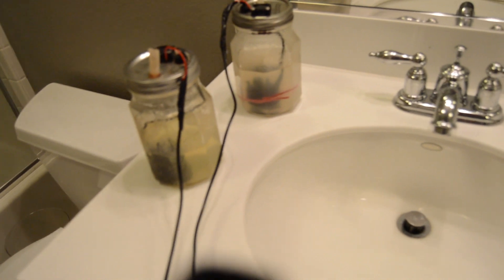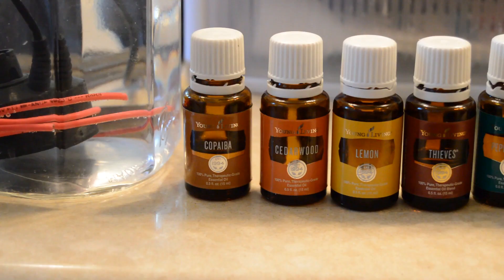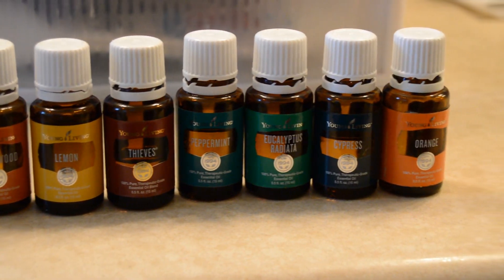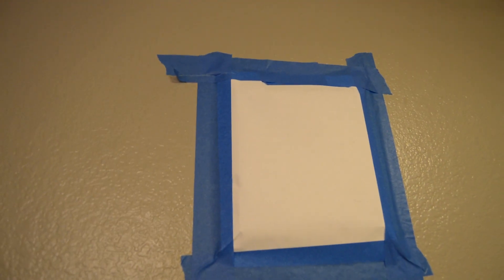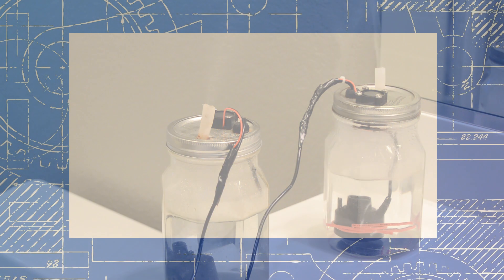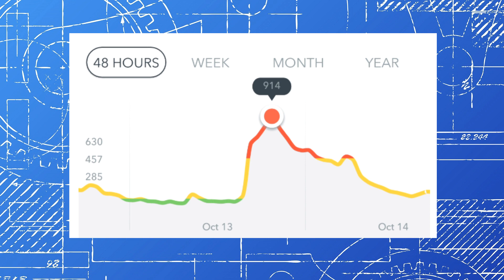Now for something more controlled to see how effective this filter is at removing VOCs. I placed the air filter in my kid's bathroom with a couple of essential oil diffusers — these diffusers were made by me, and you can see how I made them via the link in the video description. I used essential oils because pure essential oils are nothing but VOCs and will completely evaporate at room temperature. I used a lot of different essential oils because each oil can contain over 100 different volatile compounds, and mixing and matching should produce a slurry of thousands of different VOCs. To run the test, I shut the AC vent and covered the bathroom fan intake with paper to contain the air inside the bathroom. I then started the diffusers without the air filter running. After letting the diffusers run overnight, the VOCs spiked and reached a peak of over 900 parts per million. I then unplugged the diffusers and plugged in the air filter and let it run undisturbed for about a day. After about six hours, the concentration was cut in half, and in less than a day, it was back down to baseline levels.